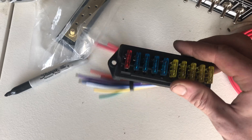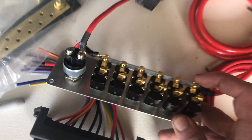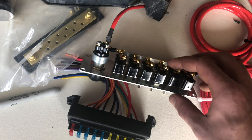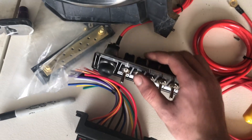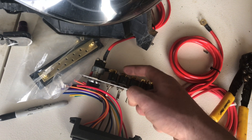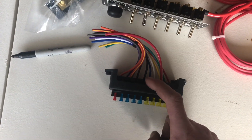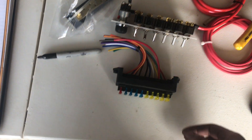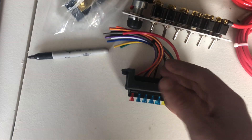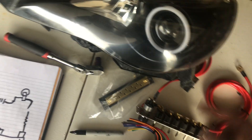So to put this into context, I have my fuse block and my switch panel over here. In order to wire up this light, basically what would happen is I would take a wire from the positive side of the battery, route it here to this power block. And then the output will be on the top when the switch is toggled — so let's say this is the headlight, I would turn it on. Power would go from the battery through here, out, and then after that to the fuse box. From the way this is set up, I'm gonna have to run the fuse box after the switch — I would like to run it before because switches can also take damage if more amps move through them than necessary. But so from there, the fuse that it's attached to would go to the light, and then the ground would just go to the chassis of the car, and then you have your complete circuit. The light will work off this switch.